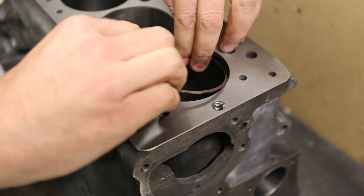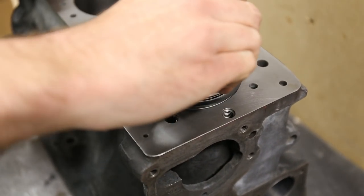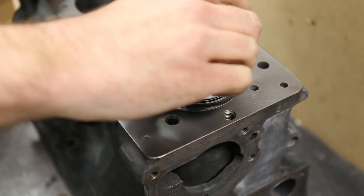When would you need to change piston rings? Piston ring changing is really a black art — you only need to change them when they're worn out. You can check by putting the ring in the bore, pushing it down square with the head of the piston, and then checking the gap with a feeler gauge. We say 12 thou; you've got to have a plus or minus, so if it were 14 or 15 thou I would deem that the time to change them. I have seen them at 22 to 24 thou, so it just depends on the application.